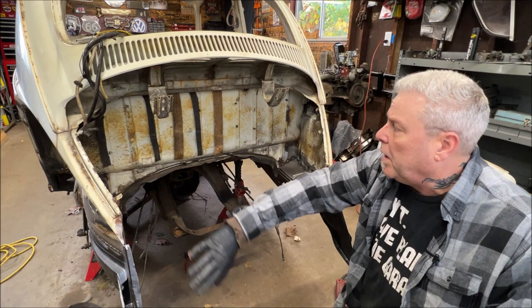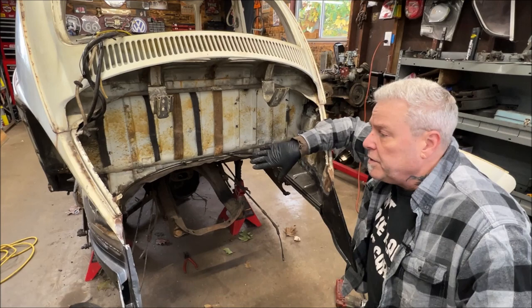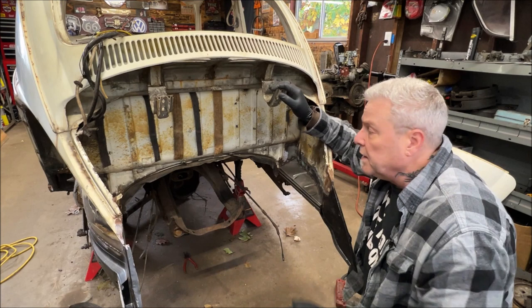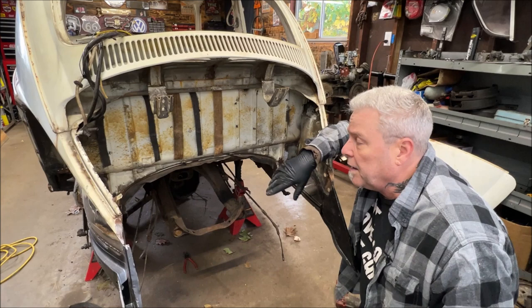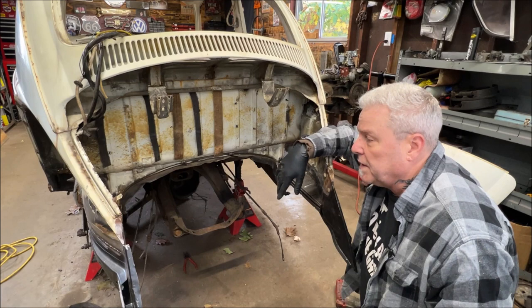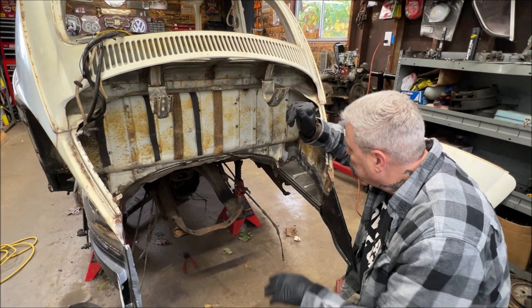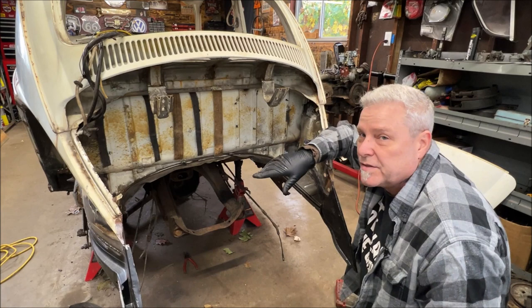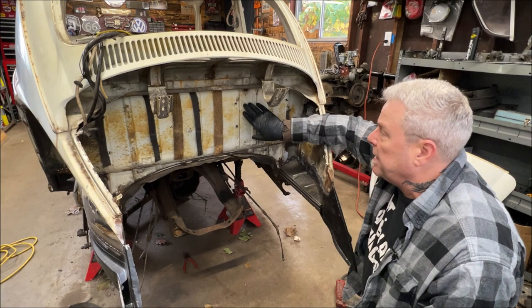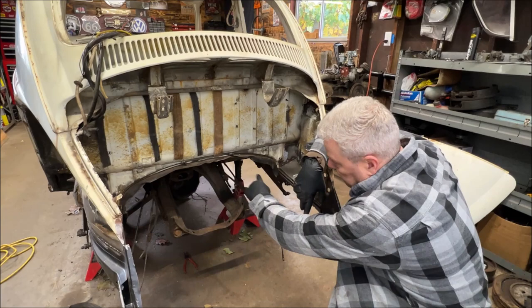What I decided to do is clean up all of this first — the engine compartment — and use the metal cleaner when I'm done, then use the rust bullet and get this all done. I was going to paint it the cream color I'm going to use, but I thought — I should rust bullet it because tar board's going to go over here anyway, so it'd be silly to paint it. I'll go ahead and clean this all up in front of you. I know this is a shoddy film, but I got to get this stuff done. We're going to get a lot of this glue and stuff pulled off of there.